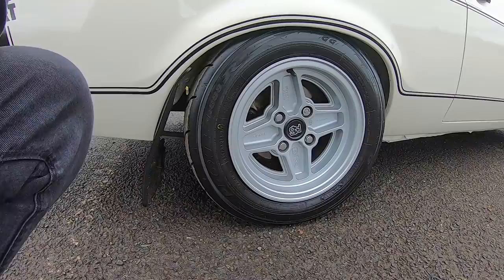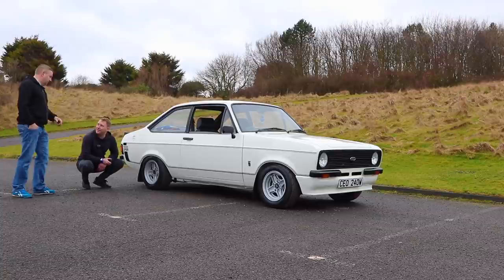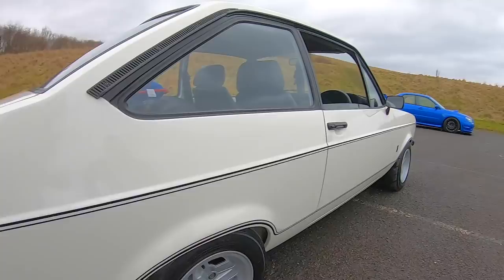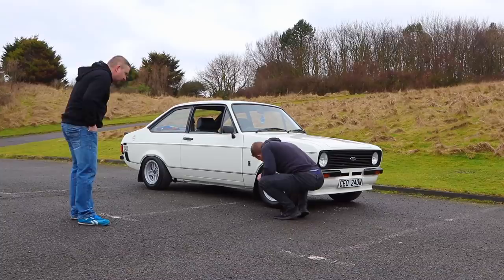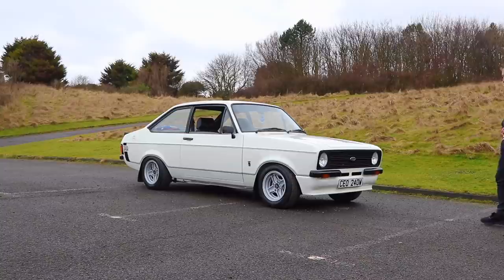They look nice — looks like a rattle can finish, just paint, but it looks really well. It's got discs all around — old-school Fiesta front discs on the back with two-wheel-drive Cosworth calipers. The four-wheel-drive Cosworth has vented rears but solid discs are all you need on the back. Classic Ambassador four-pots on the front with vented discs. The wheels are 13s. He's just put Toyo tyres on and they're a bit skiddy in the back — unless you want to slide about.